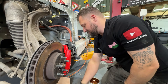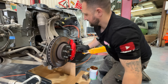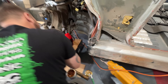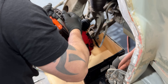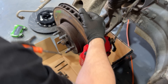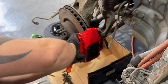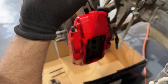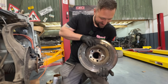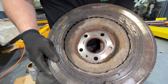There's the spring plate — one pin, two pins out. Now when you try and get the pads out I'm just trying to push the pistons back enough to release the pads off the disc. The disc was held on by all this corrosion — wow, they're bad. All this corrosion here was holding the disc over the back of the drive flange so it was difficult to get off. Look at the state of that — luckily we have some nice new ones.